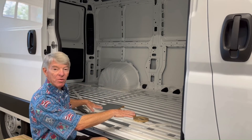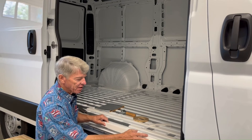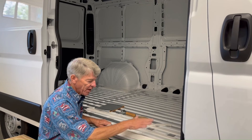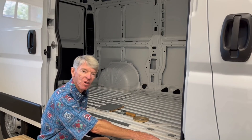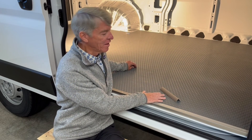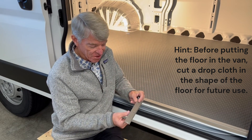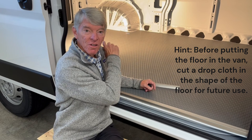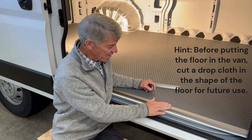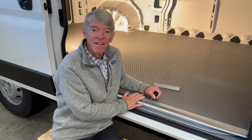After the floor is put down, I'm going to take the same PVC material, cut it to exactly the right height, and install it at the threshold so there's a really solid, strong structure for people to stand on when they step in and out of the van so they don't crush or damage the floor. The installation of the floor is now complete. I took the fabricated floor and laid it in the van, then installed non-slip stair edging across the thresholds — one at the sliding door and one across the back of the van — giving it a nice finished look. I hope this video is useful and thank you for watching.